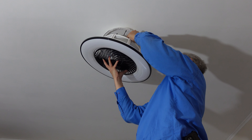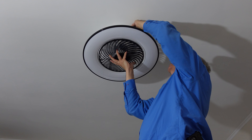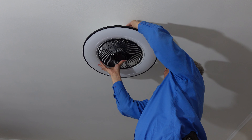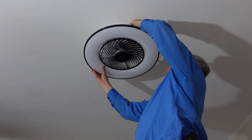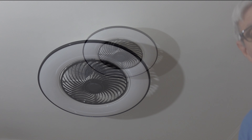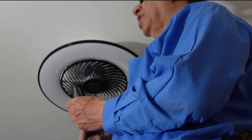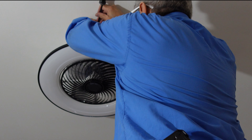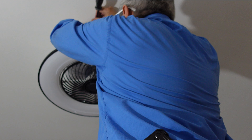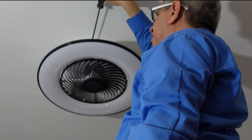Make sure the hook doesn't get in the way. Should be able to line it up — plenty of room inside that little area there. We're going to line this up with the notches on the base and twist it clockwise. It's connected all around now, and I think there's a screw to put in to lock it in place. It took a little finagling — I had to reorient how I twisted it onto the fan. There's a little notch at one end where you see the wires going to the light, and right there is a little hole that has to line up with the notch. Now I've got it lined up and I got the little screw in there, tightened up and locked in place.